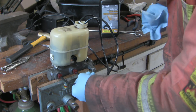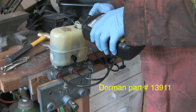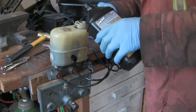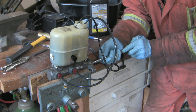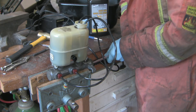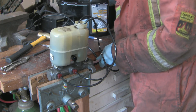I've hooked up my tubes for bench bleeding on the table and will put some brake fluid in here to get all the bubbles out. This is the Dorman kit for bleeding the MC — it uses black tubes which aren't great for seeing bubbles, but you can also look for bubbles at the top of the fluid. The point of bench bleeding is to evacuate compressed air bubbles trapped by the two pistons inside the master cylinder before reinstalling the MC on the car. I'm intermittently pushing on a rod with a blunt end to mimic pumping the brake pedal, routing fluid and air back to the top of the reservoir. In retrospect I should have discarded the first few ounces so any dirty fluid trapped inside the MC was removed.